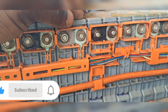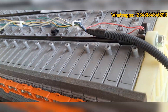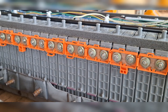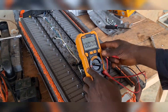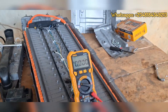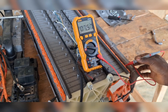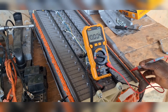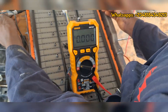These batteries are actually sweating out fluid into the space. Both batteries are nickel metal hydride. You can see this Venza bus bar — look how shiny and neat it is — there'll be good flow of electrons through those terminals. Taking measurements, all the way down the Venza modules, all voltages are balanced and equal down to the last one — a balanced 7.55 volts.